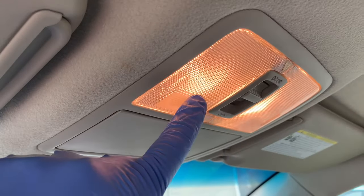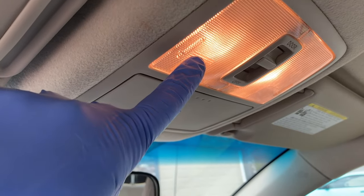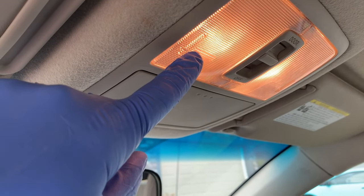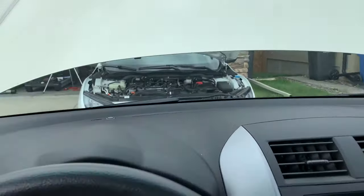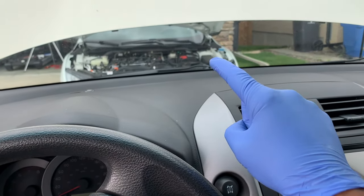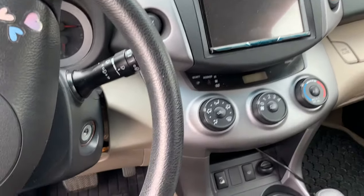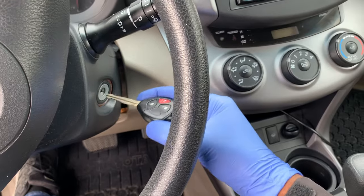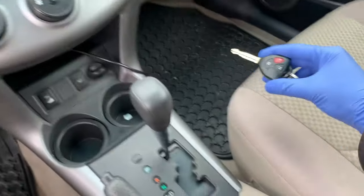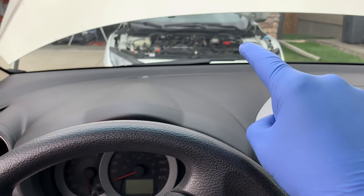The only thing on the good vehicle that's turned on is just the dome lights, but as soon as I close the door, that will turn off. The point is we want as much energy and power going to the discharged battery, so by having everything turned off it's only going to help with that. And lastly, as a safety precaution, the key is out of the ignition, and we're just going to put that in a safe spot as we hook up the jumper cables.